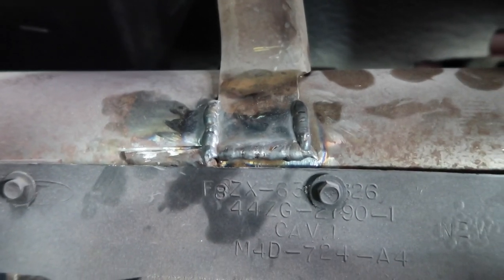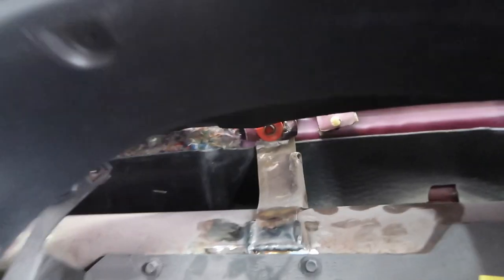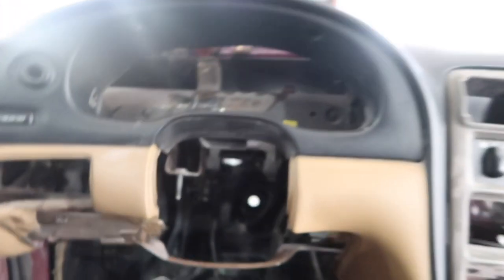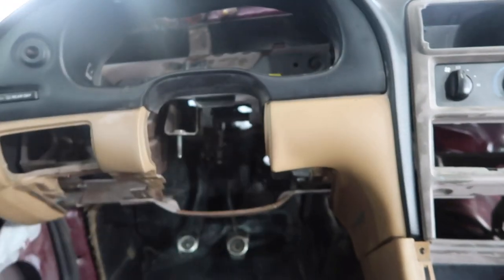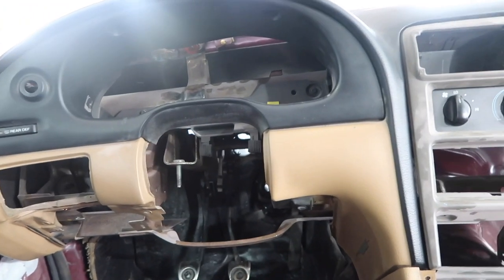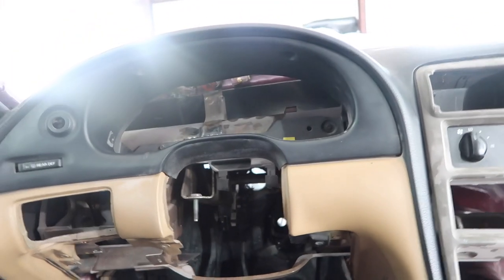I'm going to leave this frame — this is actually a 98 Cobra dash and frame that I parted out last year — but I had to cut and weld the dash bracket over an inch to the right. It bolts up nice, it fits nice, the door closes nice. I already got the SN95 pedals and everything, so all I have to do is take this dash piece off, leave the metal structure, and then put my new dash on because I got to remove it anyway to put the wiring harness in.